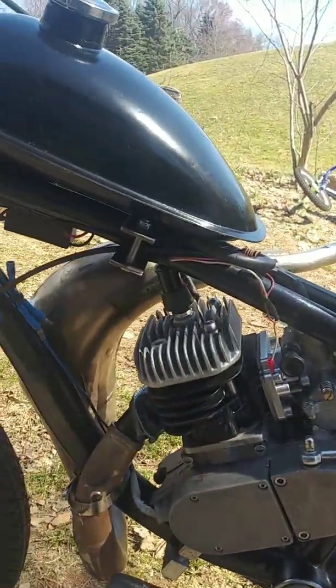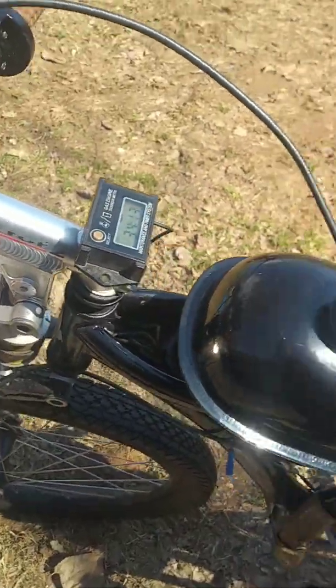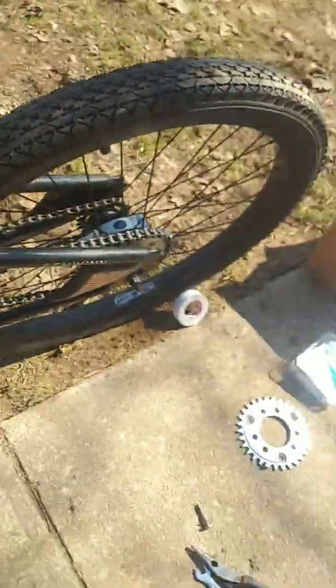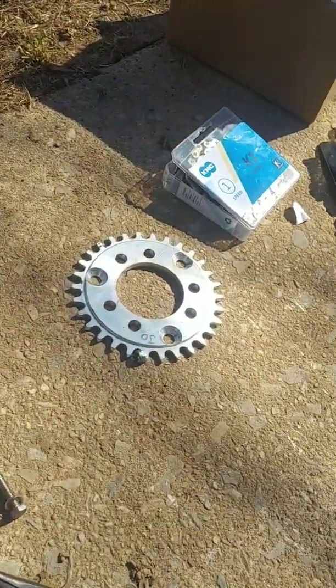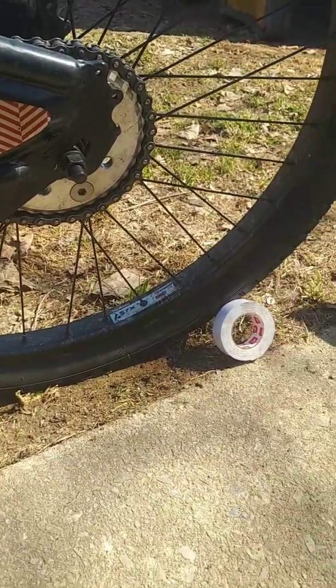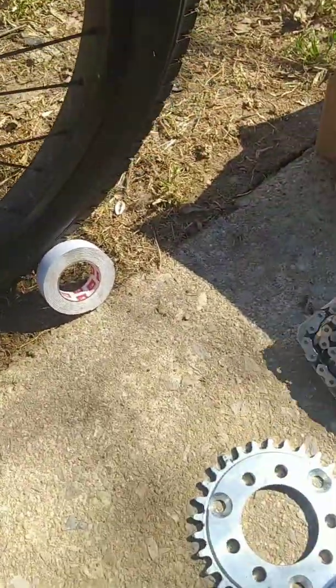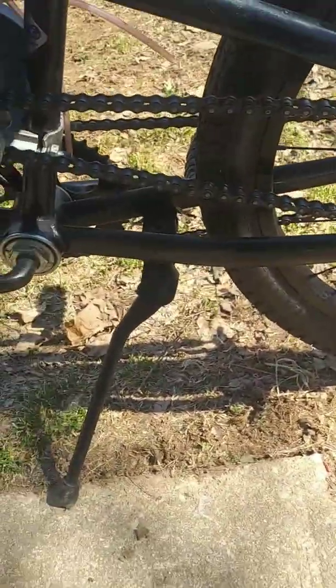Alright, it's a different day from before, but I have the ignition installed. I put the coil up in there nice and out of the way — wires are kind of ugly, but you know. I got a tachometer off the 212 bike on there today. I want to try to put this smaller sprocket on it — it's a 30-tooth; I have a 33-tooth on it now — just want to try to keep the RPMs down, and then install this fancy new chain for the regular bicycle chain side.